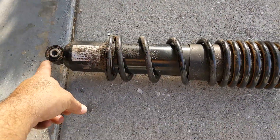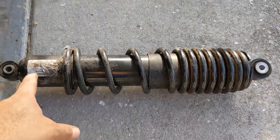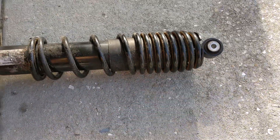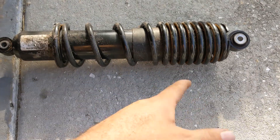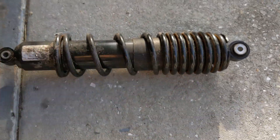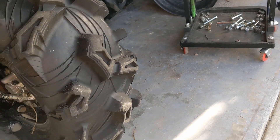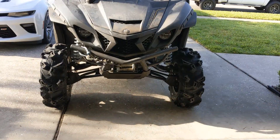Someone also asked what size limiting strap I recommend on the X4 if you're running a high lifter bracket lift. The high lifter bracket lift gives you too much angle, so if you want to run that safely, you need a limiting strap. This measures 19 and 3/4 inches from eyelet to eyelet. I recommend probably an 18 and a half inch limiting strap — that'll probably stretch a quarter inch, giving you an inch less down travel eye to eye, which will translate to about an inch and a half to two inches of down travel at the wheel because of geometry farther out. So that'll protect your axles.